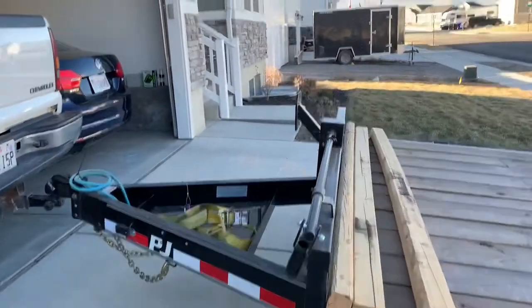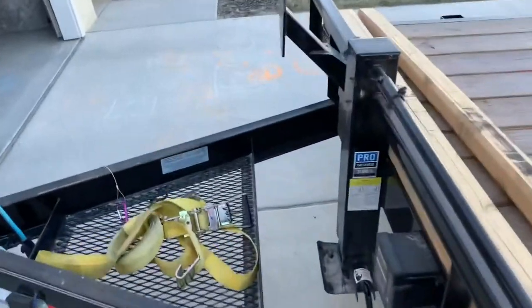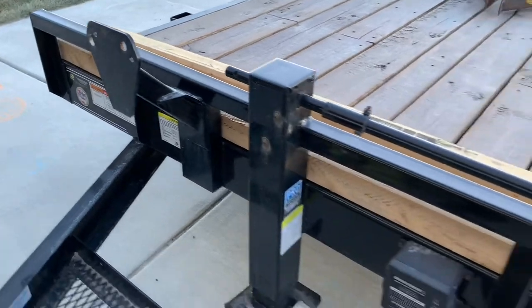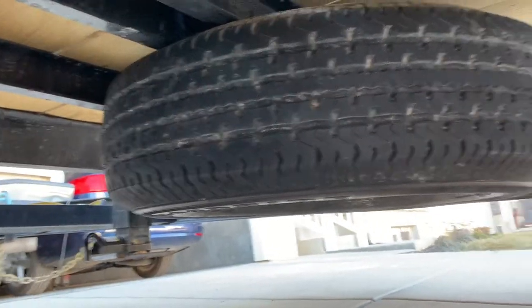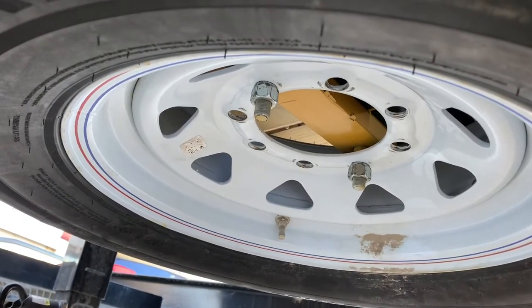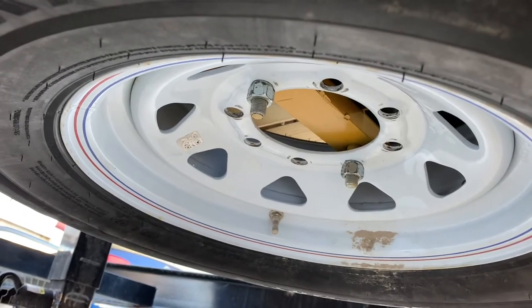No more tire on the front. Still gotta cut this mount off. Kinda ugly, but it can stay for now. I got this tire under here. It doesn't hang down as far as the jack. It does hang down a little bit past the frame rails, but nothing too bad. I've got enough stud hanging off there. I'll pull it back down, drill them studs for a cotter pin.